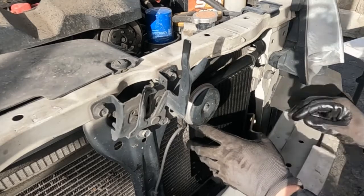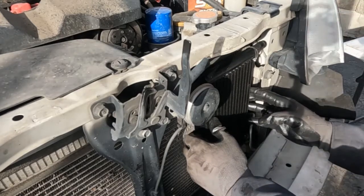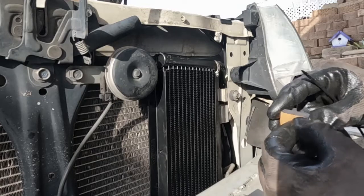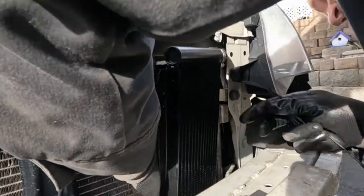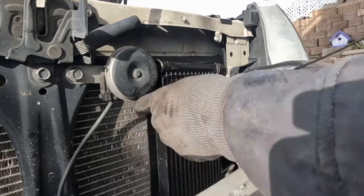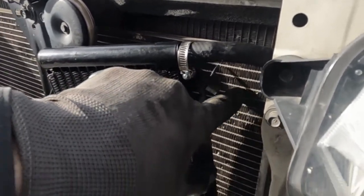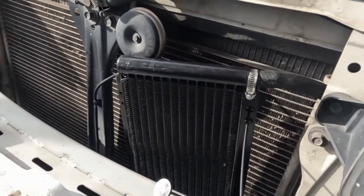So before cutting that down, I'm gonna mount this just the way it is in a good spot. And then I can pull on the hose and make it the exact length that I want it to be. All right, so they give you these in the kit. So what we want to do is get our foam, pop the little center out of the foam, pull our paper off the foam, and that's going to go on the back. So my arm's going to be in the way for the first one. I'll show you in a second. Line this back up and put it on the top. Here, let me show you. So you can see how I have it. This through the hole, and then the styrofoam in between the cooler and the condenser. And then this will just get pushed through the fins on the other side, and then we'll put these caps on, and that locks it all into place.